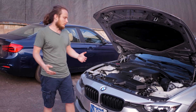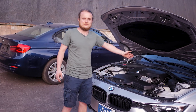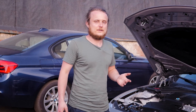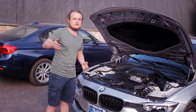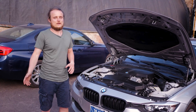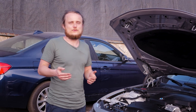Typically what we do on this engine: we change the heat exchanger gaskets, the timing chain, the valve cover and pan gaskets, and the spark plugs. Plugs are changed at around 60,000 to 100,000 kilometers depending on how it turns out. Mostly these are cars coming from America with mileage from 50,000 to 150,000.